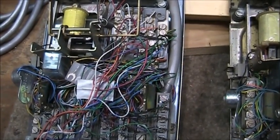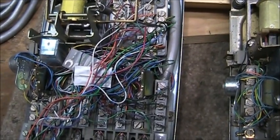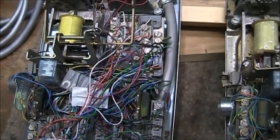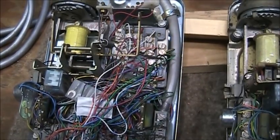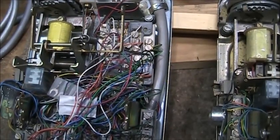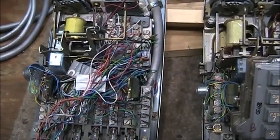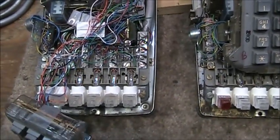The 564 does the same thing as the 2564 — there's only one single lamp ground. You can bridge, using a CPC connector, a 2565 and a 2564, and you will not have any troubles at all. The only difference is both telephones will ring, but that would be under pretty much any normal circumstance.